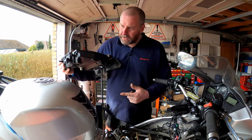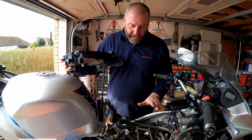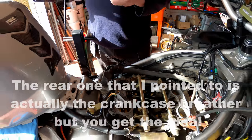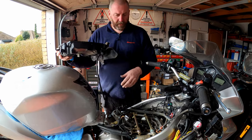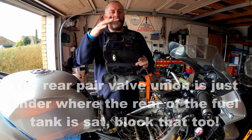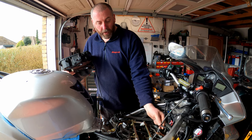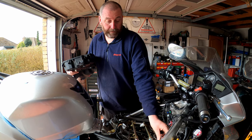Okay, as you can see the airbox is off and the fuel tank has been turned around and placed under a big thick folded sheet. Everything's removed. I've had to remove the pair system and block the inlets — I've just put a bit of tape over them and wrapped some more around to seal them up so they're vacuum tight. All the sensors are currently disconnected — your temperature sensor, your MAP sensor, etc. This hose here I've just clamped so that it's sealed up so we haven't got a vacuum leak.